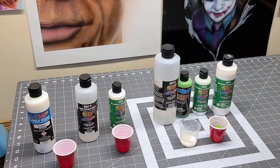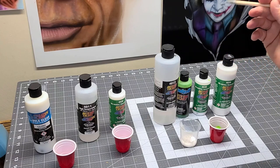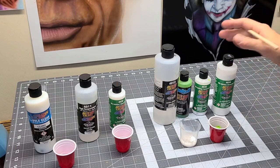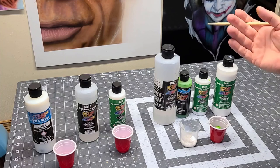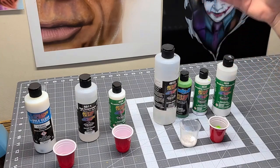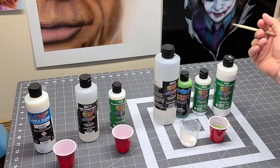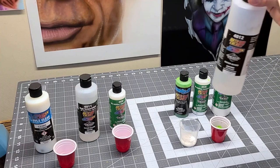We're going to start off with the 4030 Mix Additive Balancing Clear. It is a water-based polyurethane clear. For a lot of you that might have abandoned this product because you found it didn't mix well, I'm going to show you the corrective action for that today. Myself and a lot of people out there that I've discovered on the internet had the same problem. The problem was with the 4030 is they came out with this balancing clear for two reasons. As an intercoat clear, it dries with a matte finish, so it's not for going over your artwork once you're done, but what it is for is to go over your artwork in between coats if you want a clear on there. But the problem was that something wasn't working quite right with the 4030 and the 4012 reducer.